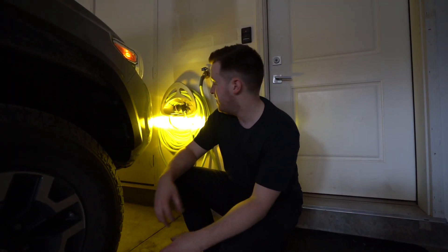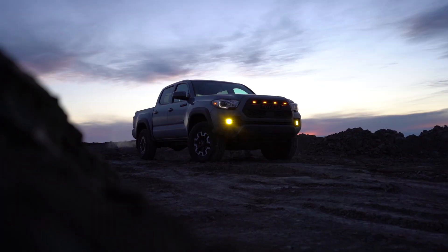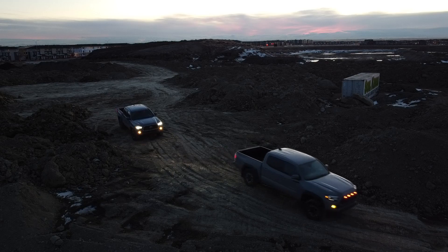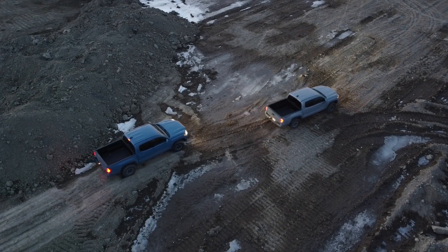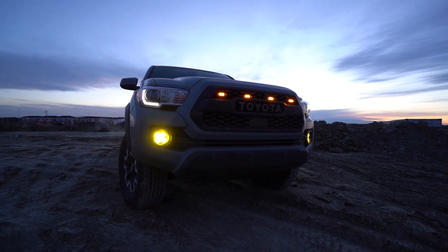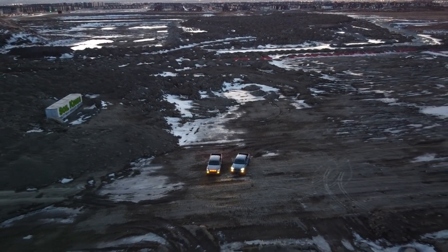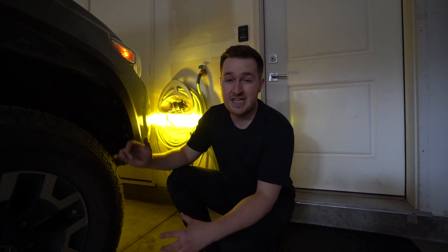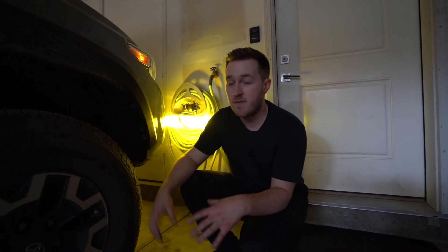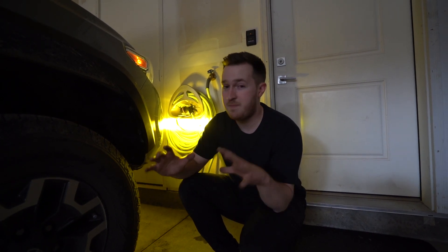With that, we're finished with the install of the fog lights. They look pretty sweet here in my garage. I'll cut to some footage out driving and showing them in the dark. The total install time took just under an hour — give yourself a bit of time to get those fender liners out, it does look easier than it actually is. You'll definitely want to test them before you put everything back together, because the plug that goes from the truck into the back of the harness can be put in backwards — I ran into that, so just flip it around and test it before you put it all back together.